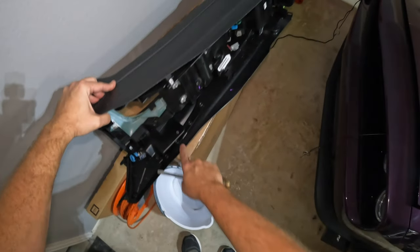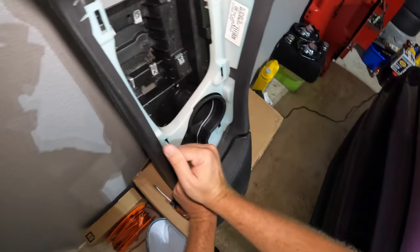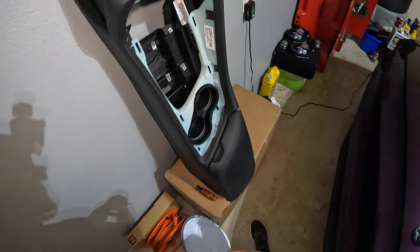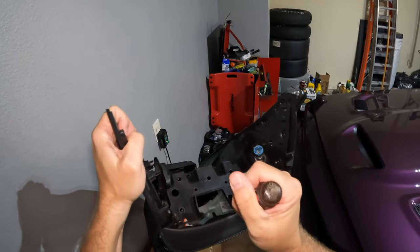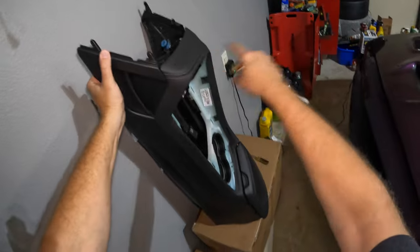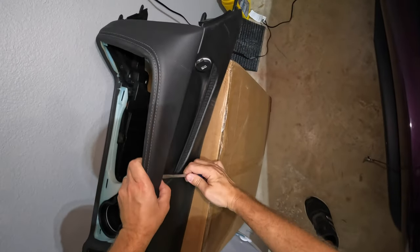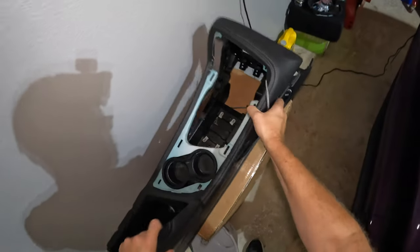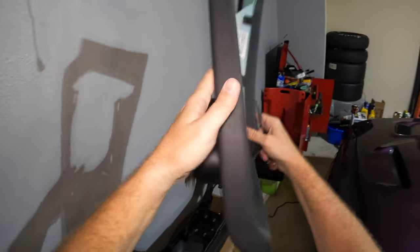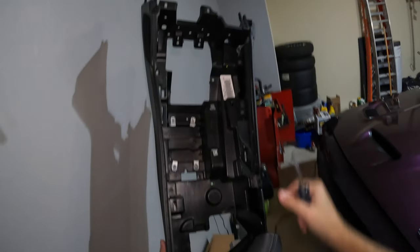Looks like it's not all clips — there is one little screw right here, and looks like there's a screw over here too. This is one of those times where I'm just finding everywhere things are attached and pulling it off. Nice thing about this: I'm going to destroy it anyway, so I don't care if I damage it. Now this trim bezel is separate, so we're pulling this off too. It has an electrical connector — this is just for the lights around the cup holders. Now with that out, we have seven more screws to get off.